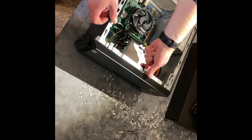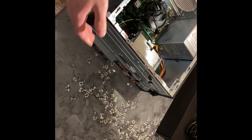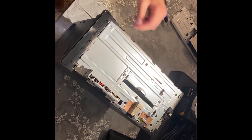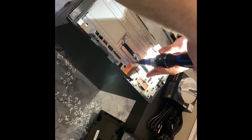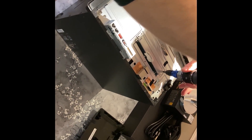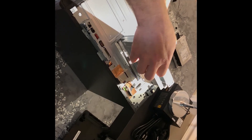We have to take the face plate off, so we just unclip each of these little clips and your face plate should come right off. That's going to give us access to the front. We're going to remove these three screws and pull the CD drive right out — it's a bit tighter than expected. Then just pull on the tab and your CD drive comes out.